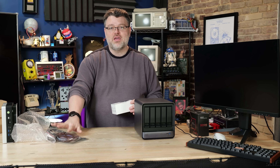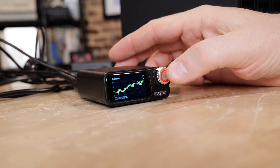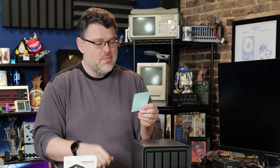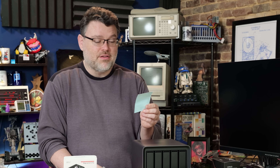What do you get in the box before we get into the fancy accessories? It's got a knob and an LCD screen and a little interface. Power is 5V 1A or PoE. If the screen is black, avoid incompatible USB hubs — some only work at 30Hz. On Windows, go to Settings > Advanced Display, then set the resolution and refresh rate.